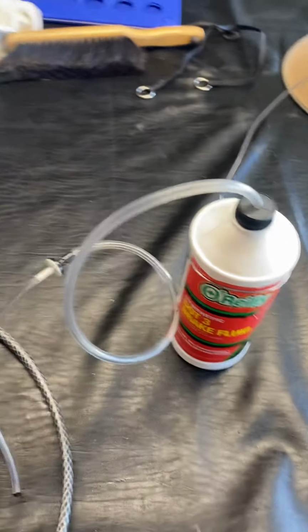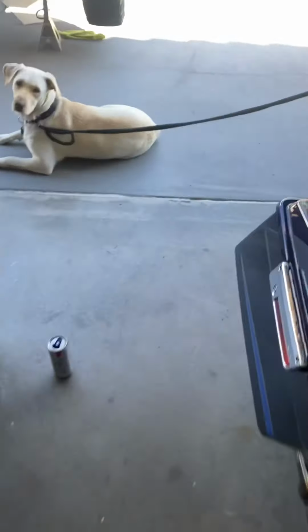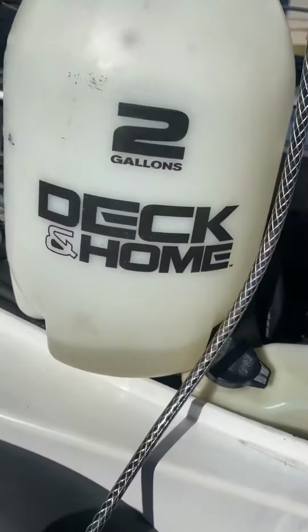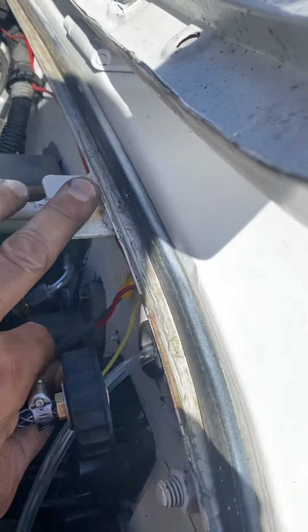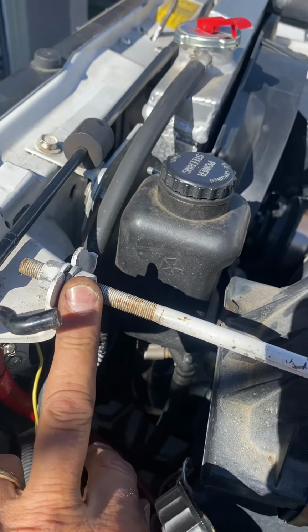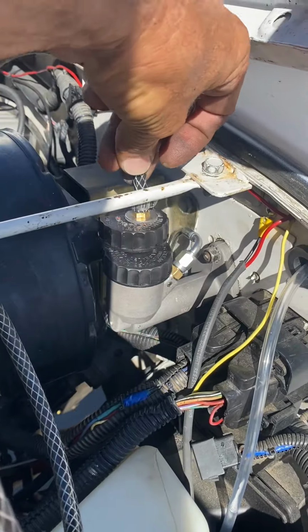So, after I had it all set up, I took this guy here. Let me take it out here. Pardon the Blair Witch Project stuff here. Put it up on top here. You'll want to remove your fenders, your strut bar here. This will be two half inch wrenches. Just got to loosen up this 9/16 wrench. You guys know how to do that. Get that out of the way. It's just going to be in your way because you're going to want to get this guy screwed on there in place.